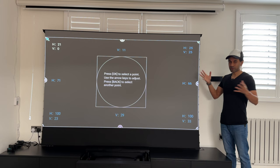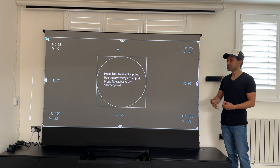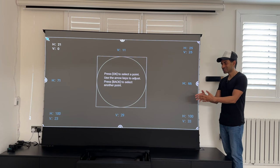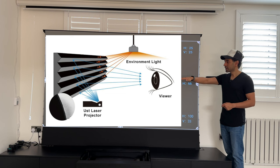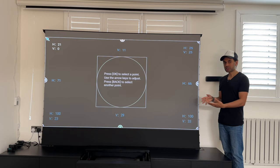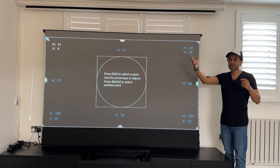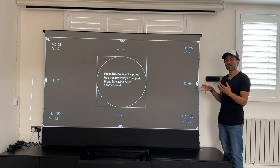I've put the daylight back into the room — a lot of sun coming through the windows and skylight — and you can see how much clearer everything is to see and read compared to the matte white screen. The screen itself has a semi-translucent gray-edged design. This fabric is specifically made to reject light: when the laser projects from the floor at an angle up to the screen, that light and image is reflected horizontally back to the person watching, rather than scattering in all directions like the matte white screen did. Ambient light from skylights, ceiling lights, windows, and daylight all come from various directions — this screen rejects all of that ambient light.